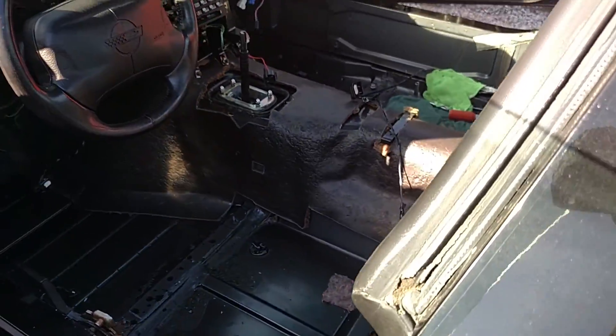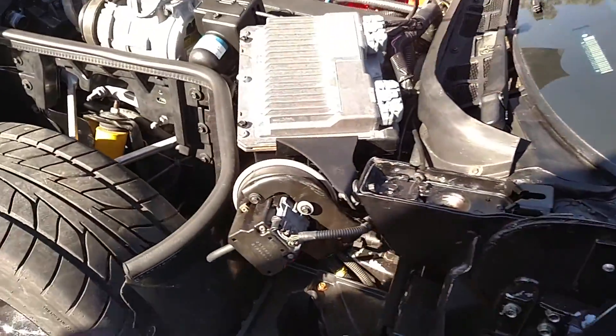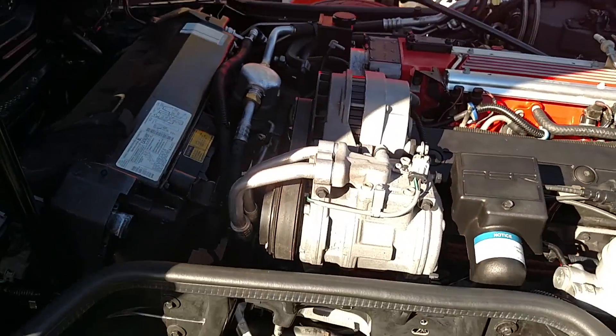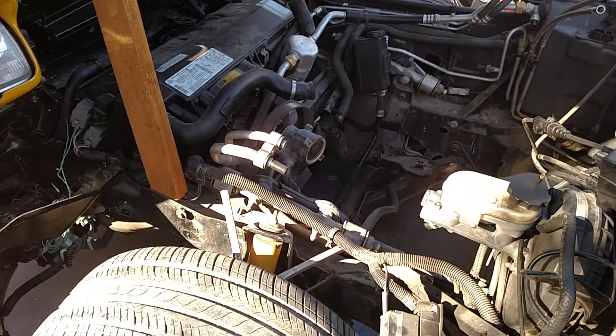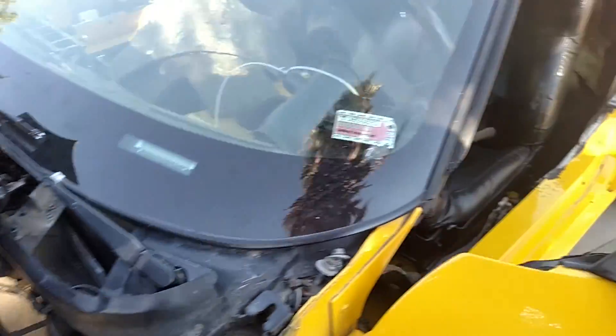Buttoning up that wiring - there's the hurst shifter. That's the ZF 6-speed, by the way. A lot of people call me and ask for parts on these cars and they think they came with the T56 - this one's not a T56 car. These are the ZF S640 model transmission, it's a German build. I actually like it a lot better than the T56. This car I'm going to take a few more parts off of and then send it off to the scrapper.